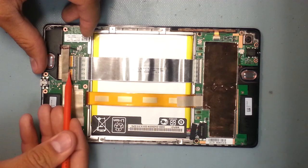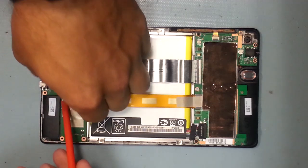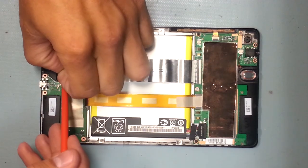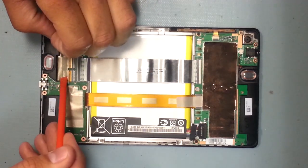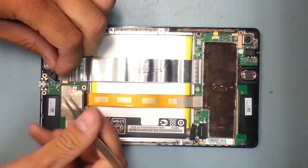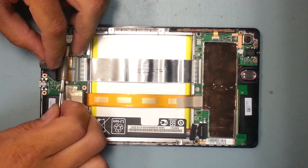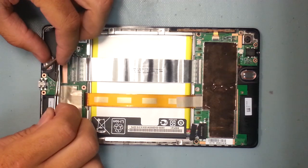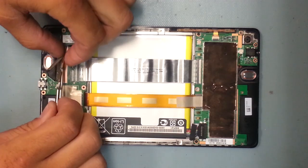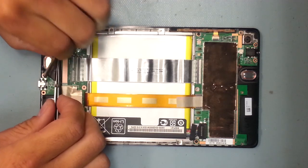Once it's flipped up you just have to pull them out. What I did with the smaller ones is I lifted up this little spongy tape, and once I got the tape up I was able to slide my tweezers underneath. The two little ribbon cables pulled out of their slots and that released them from the circuit board.